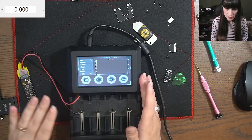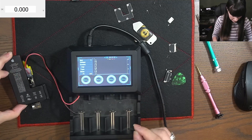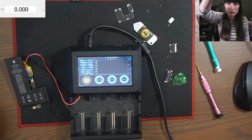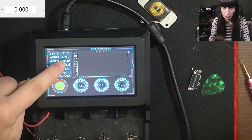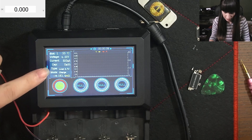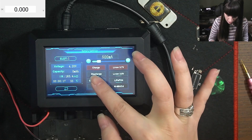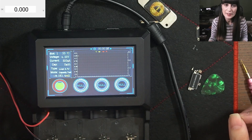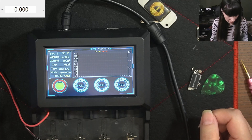Battery is out. Let's test it. So we have this device here, which is a battery capacity tester. We modified it to test the iPhone battery. I'm gonna plug the battery right here. I'm gonna zoom in a little bit. My battery is almost fully charged — the voltage is 4.2 volts. It shows the current, the capacity type, mode charge. So we're gonna test the battery capacity. This test will take around one to two hours, but the tester is very precise. Now it's in mode capacity test. We're gonna leave it like that and see what capacity my battery has.